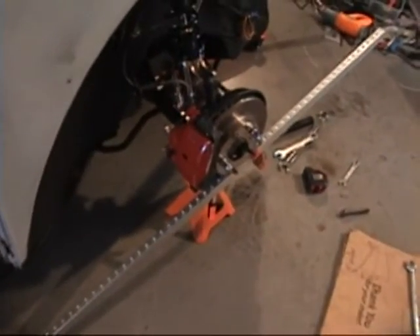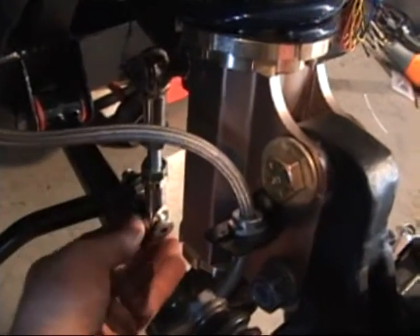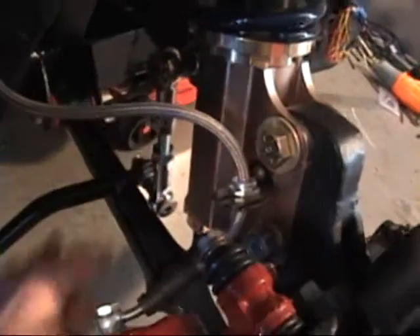I've been waiting on a few things to get the engine started — I can't get it going yet, got to wait. So I've decided to come up here and fix my strut ends. I've got these spherical rod ends and a 10mm bolt here in the middle of it. This will be a lot stronger than what I had on there.